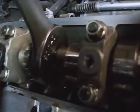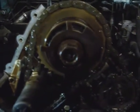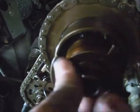I've got a backup wrench on the hex head on the camshaft — inch and a sixteenth on there, fits up pretty good. I'm going to take this nut off the fastener; it's left-hand threads. These sensor wheel nuts are 24mm — or 15/16ths will fit it — and they're all left-hand thread, so you're going to have to tighten this one to take it loose. And it's loose. This one wasn't on very hard at all.